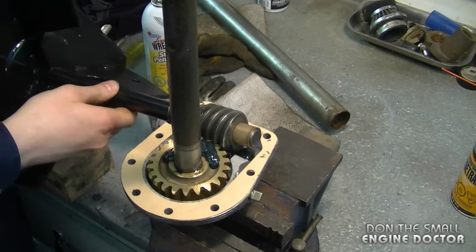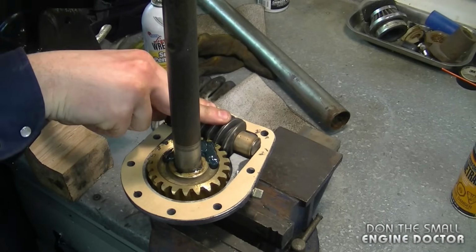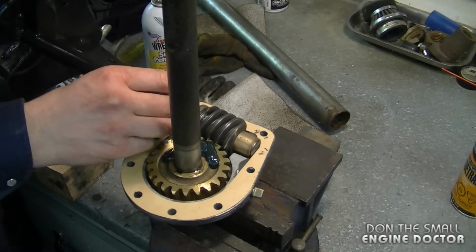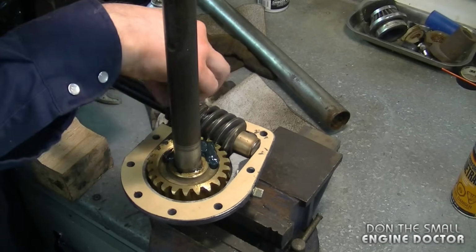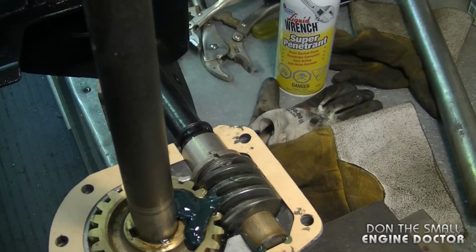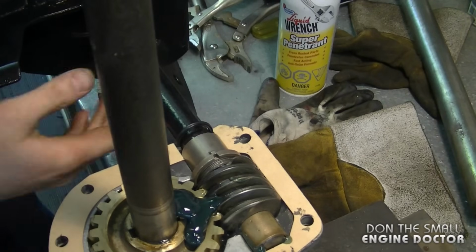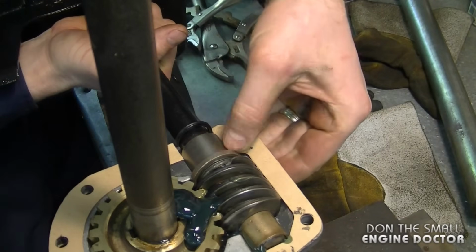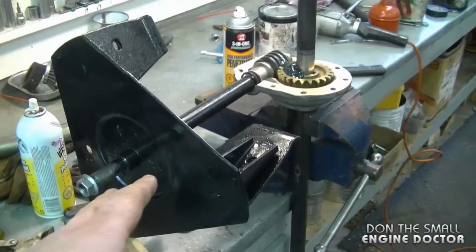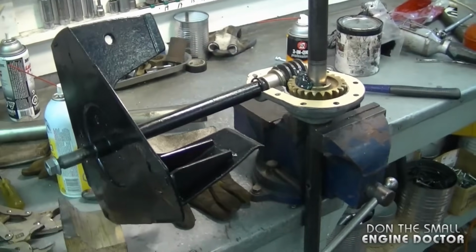So first you want to lift everything up. Get this gear down, get this bushing in its hole over here, make sure the quad ring is in its place at the back. So you may have to turn the impeller just to get everything down. While you do this, hold all your parts. Now it's a bit precarious, so don't move it too much because everything could come apart again.